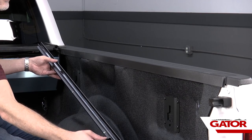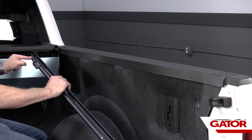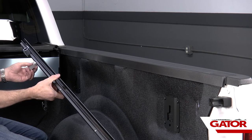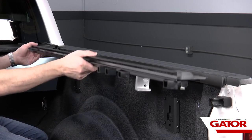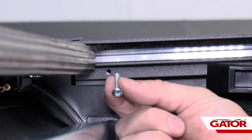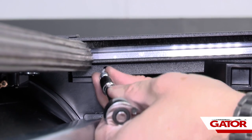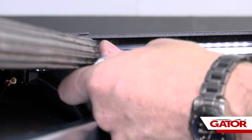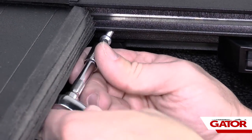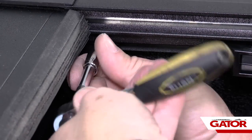Now we're going to slide our front latch position all the way up to the front, making sure we don't go past the little hole in the end of the rail. We're going to slide our front clamp all the way up in that location as well, line this up to the bed cap, and slide this into the canister. We're going to use a self-tapping screw with a T25 Torx head, line that up, and go right into the drilled hole — we're going to tap our threads into it as we install this screw. Make sure you keep everything nice and straight, as we've got two sides that we're going to thread into.